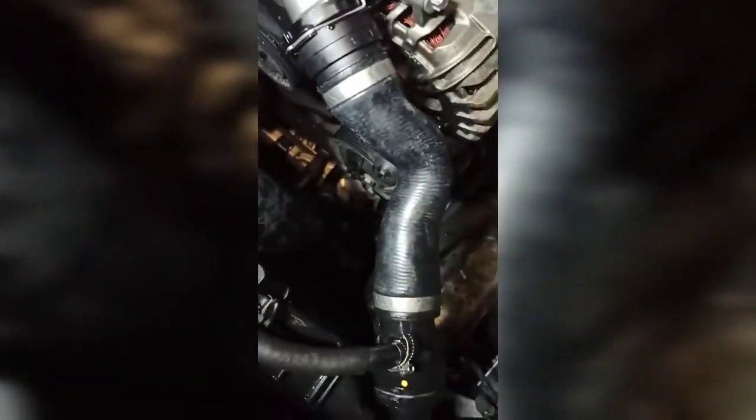If you're buying this hose, it's a little bit different. The part number will be in the description. On the original hose, this side is just a regular rubber hose all the way up to here, then you have a harder rubber or plastic section, then rubber again. But on this replacement hose they made it hard plastic all the way around. You'll also need to get your own clamp.